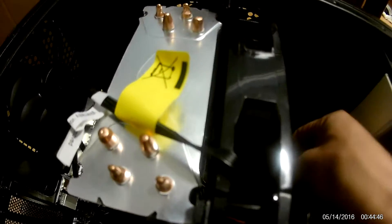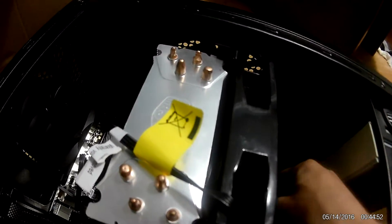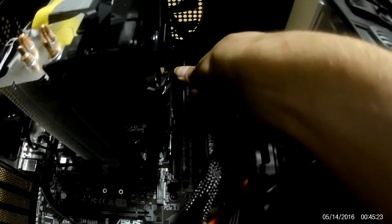You have to make sure you're lining it up and it's orientated the right way when you install the RAM. So line it up nice and like this — line it up with the RAM module on your motherboard. Once it's lined up, you're just going to push it in until you hear a click. It might not always click, but you want to push that in. You'll hear the click — click, click like that. And that's how you install RAM.